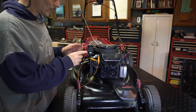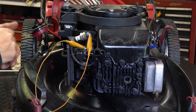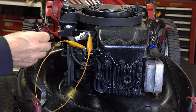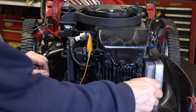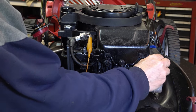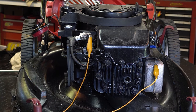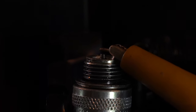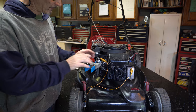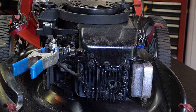Now I've got the plug — a new plug — with a wire clipped to the grounding electrode connected to the body of the plug. You need to find a good ground spot on the chassis. I'm rotating around, trying the muffler area where the bolts go in. Let's turn the lights off and give it a pull to check for spark. It fell off initially but I clamped it. I don't think the water was the issue, although it is an issue — we still don't seem to have spark.